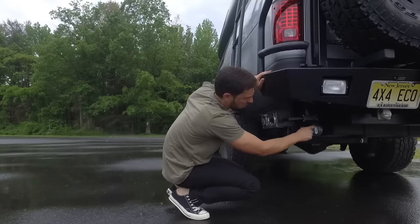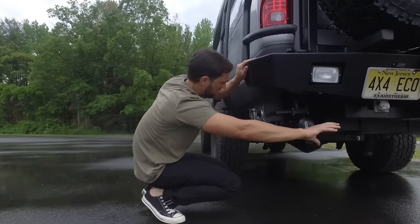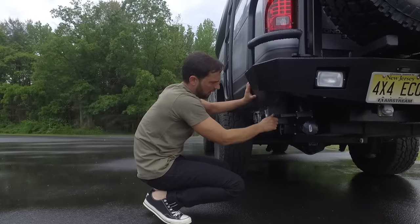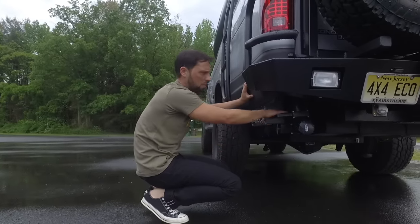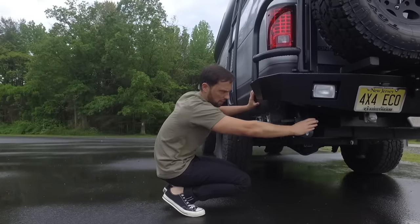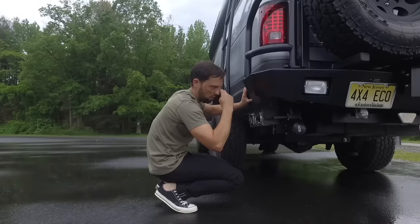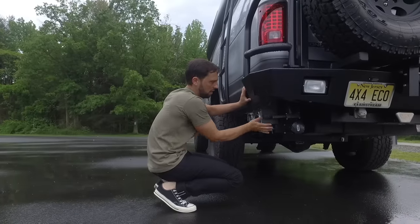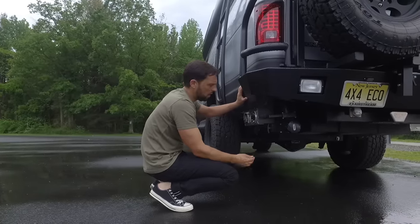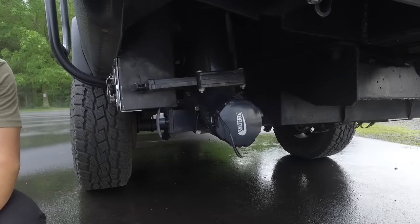The discharge is here, so I take this cap off, I take my waste hose out of its storage tube, snap that on, and then, best practice, I always open my black tank first, which is toilet, pull that straight out. Now you have solids and debris in your waste hose. When that's done draining, I close it, I open up my gray, which is sink and shower, and that helps clean out and discharge the waste hose.